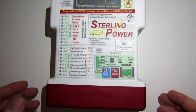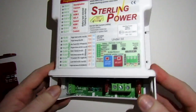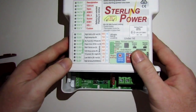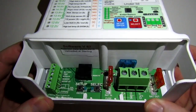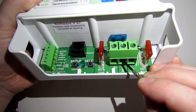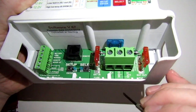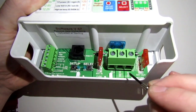First I'm going to show you the wiring side of it. On either side there are two clips — just push them in and the cover comes away, it's as simple as that. There are two fixing points on either side to secure it to the wall or inside a bed cabinet, wherever you're placing it. The main feed here is for your main vehicle battery, the second one is your negative — wire that straight back to your battery or to an earthing point — and the third is your positive to your leisure battery. Those are your three main battery cables.